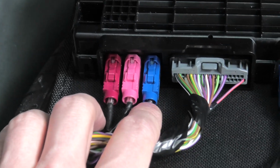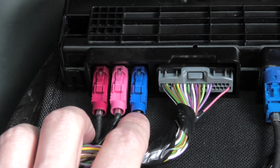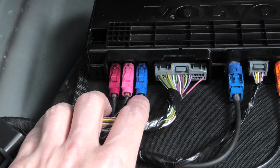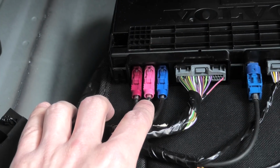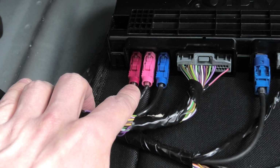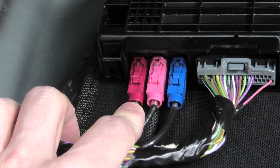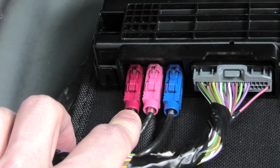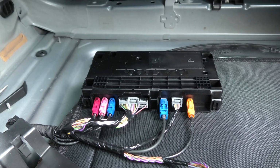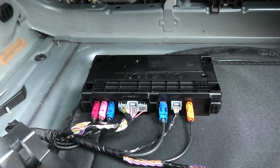The blue connector right here is input for the GNSS antenna or Global Navigation Satellite System. It supports GPS and GLONASS. The pink connector is used for external 3G or 4G diversity antenna. And the last red or violet connector is used to connect external 2G, 3G or 4G antenna. A more detailed description of the connectors and the VCM module is available in the VCM user manual, and I will leave you the link for it in the description.